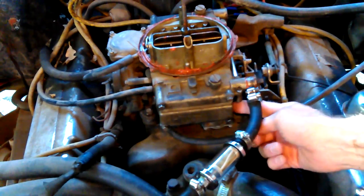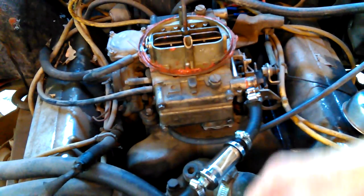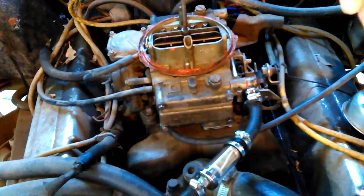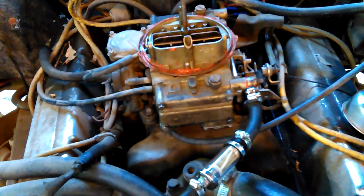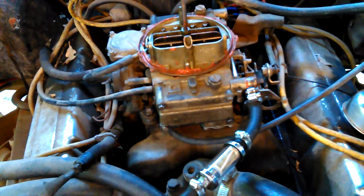It's already charged. It should crank just fine. I charged it yesterday. I realized when I was done, I didn't know for sure exactly when I started. I either worked on it for 3 or 4 hours, and that charger was on there most of the time. So I think all that noise was the battery, and there was some stuff dripped down on the ground there, and I thought it was from me mashing on this water hose and shoving it out the overflow. But I thought, well, maybe that tank has a hole in it or something, because it has a tank. And then I realized, I think that might have been the battery bubbling over a little bit.